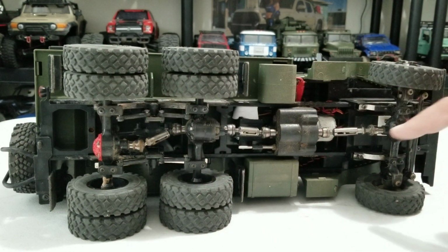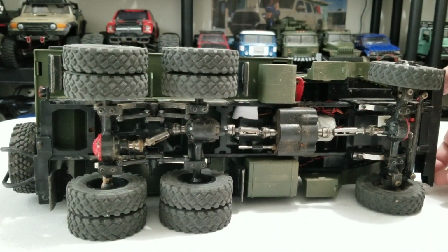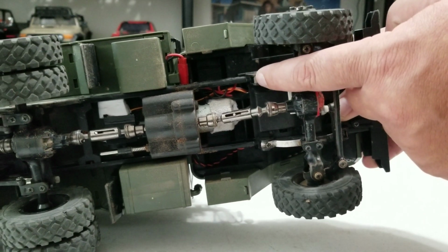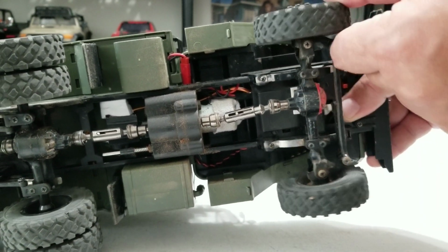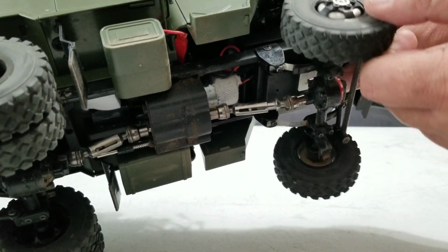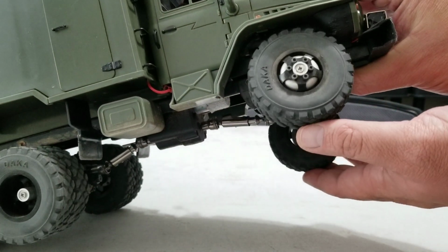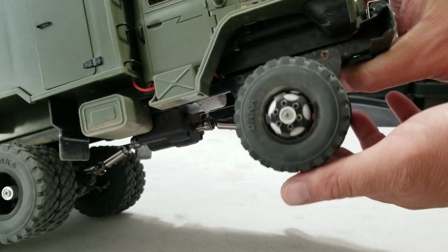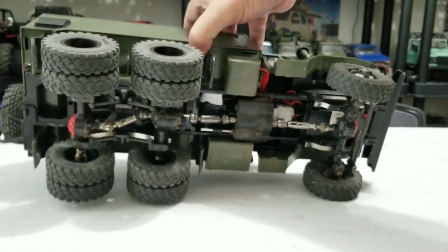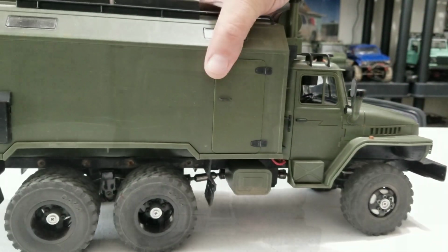There's nothing special about this rig really in setup because this is how the KM would be set up underneath. The only thing I changed obviously was these 2 screws right here are long screws, so that way I can get more flex. As you can see, that leaf travels up and down now, so when I articulate, I get a lot more flex out of it. Yeah, so that's pretty much it for that.